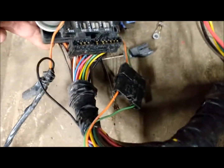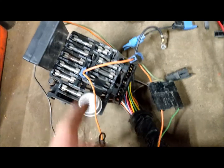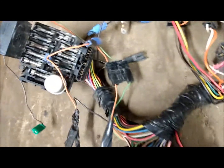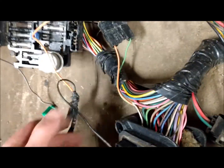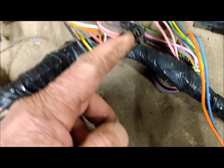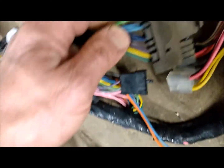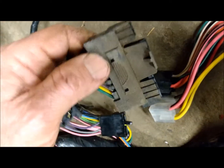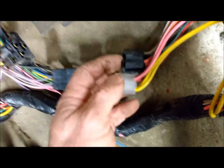This one had the clock in it and it was cut off. The clock takes power from there and then there'd be a ground wire to the wall of the car. Again you have your horn relay, turn signal relay, your ignition, and your ribbon cable for your horn, washer, turn signal, emergency flasher, and ignition.